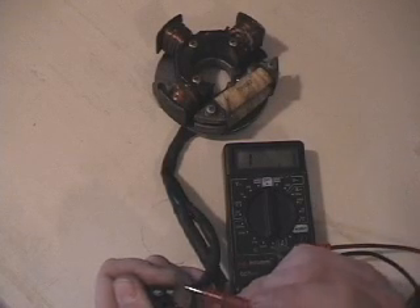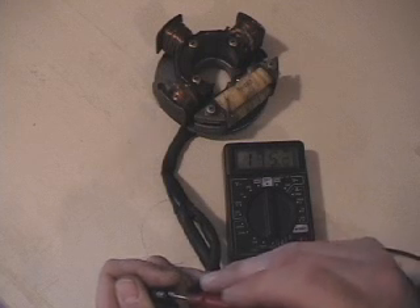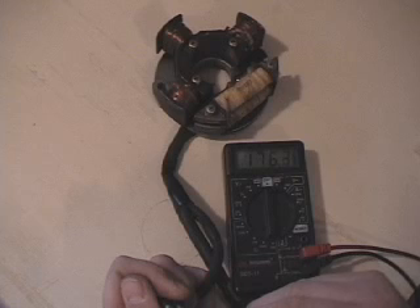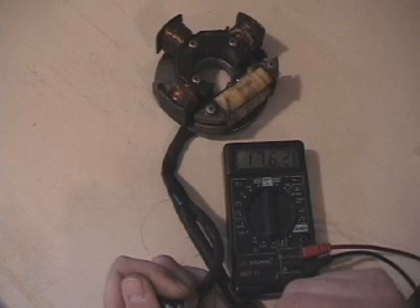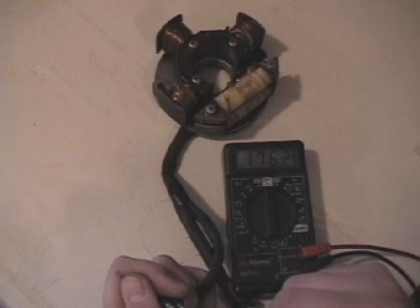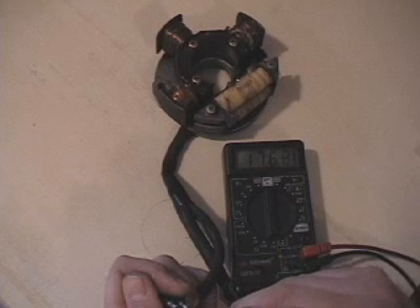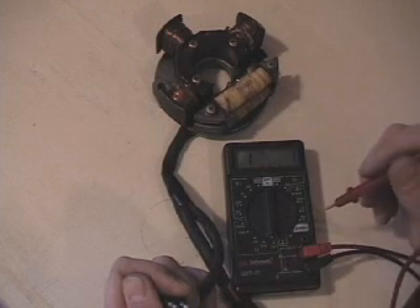Our last reading is female to the top-right male, which puts both coils in series. You can do a little addition in your head and get most of the way there. We read 176.2 — 176.3 — and of course that varies just a little bit because of the wire, so it might not add up exactly every time. We know the ignition coils on this 1994 ZR580 stator are good.